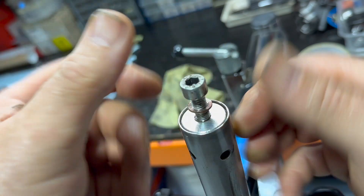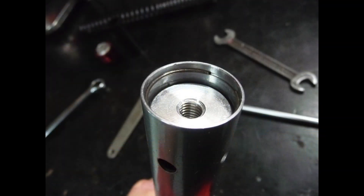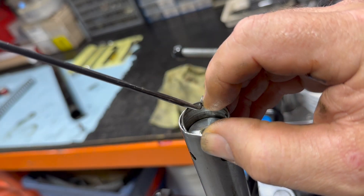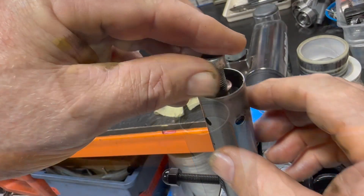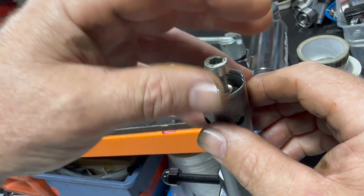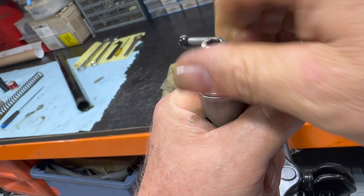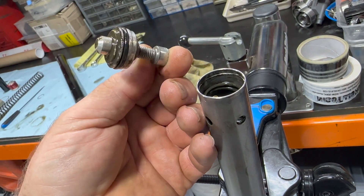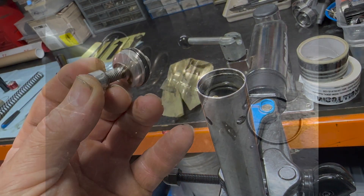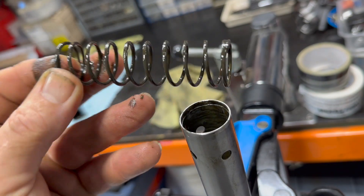We need to pull this apart to re-prime it — clean it and re-prime it. There's also one problem to address: push that cap down and you'll see there's a little circlip in there. Get that circlip out with a little pick, and that allows you to get that bush out. Use that bottom screw that was holding it in to help you get the bush out — it's got an O-ring on it so it's a bit tight, especially in a dirty old set of forks like this. Just a gentle wiggle and it'll come out. Underneath there is a bottom-out spring — pull that out.